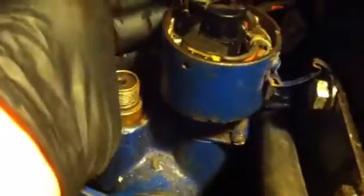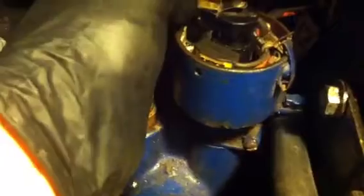The rotor doesn't really matter where it's pointing as long as when you put the distributor cap back on everything's in a convenient spot. If I don't insert my distributor in this orientation, the clips are going to be in an inconvenient spot that I won't be able to reach to clip the distributor cap back on. So to install, you have to have the distributor in a reasonable orientation.